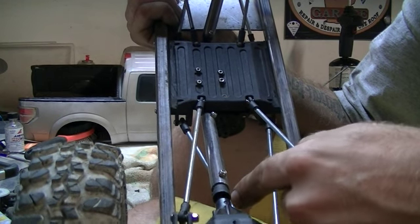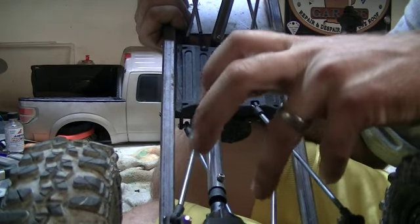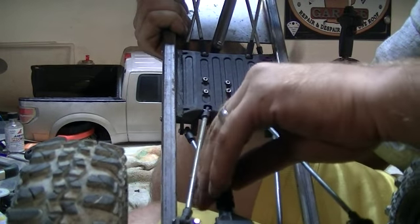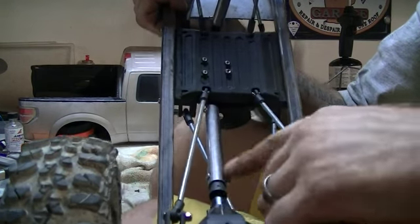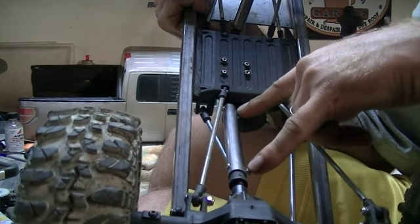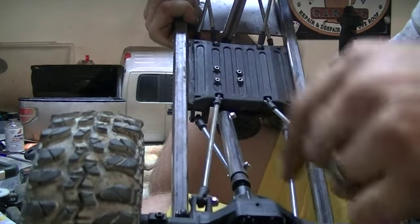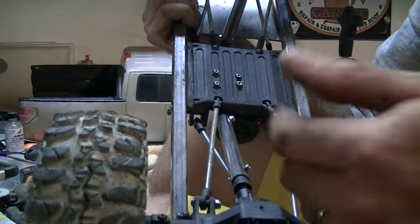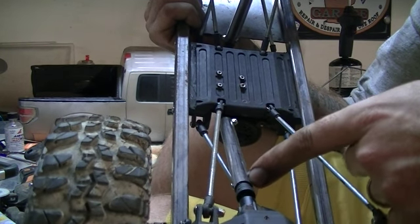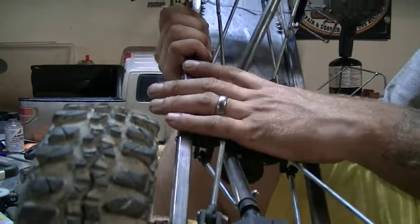You have to shove these in there. Basically what you do with this steel tubing is make it to the length that you want. Then, just as a double fail-safe, I'll take a little M3 bolt and a nylock and run one on each side — the front and the rear of the shaft. So basically it's a bulletproof shaft. The only thing you'd destroy would be the end bells, because you're not going to twist the spline since you're screwed through it. The front is set up identical.